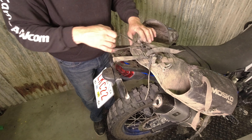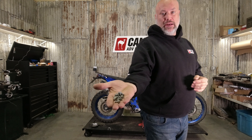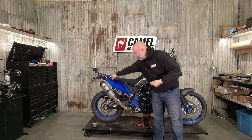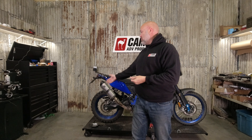I find it really useful to carry my Pelican case with the drone in it. So you're all wrapped up with the install. We've got a dozen of these shoulder bolts and they're going to go back to the plastics here — three here, three on the other side, and three on each side of the tail. I'm not going to go through putting those back in — you know where they came from, you took them out. I would recommend doing this with a torque screwdriver rather than an electric impact gun. The plastic bits on here are fairly fragile and it's quite easy to crack them. If you have any questions about the minimalist cargo rack for the T7, as always: info@camel-adv.com. Thanks for watching.